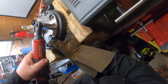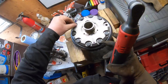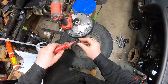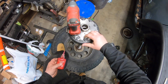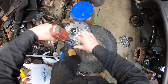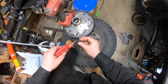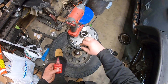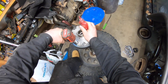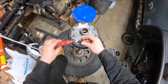That's why I'm tightening it up. Once it's cooled off, I'm going to remove the bolts and then set them back up. After about an hour or so it's cooled down — I'm pulling the bolts out again, putting some red Loctite in, putting them in finger tight for now. The purpose of this is: if you do this while it's hot, the ring gear is already expanded, so when it shrinks there's a good possibility it may break the bond. And since the metal is expanded when you go to put it on, your tolerances for your threads are going to be out a little bit too, so there's a greater chance you may end up stripping it.